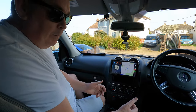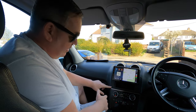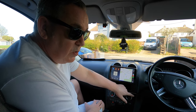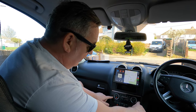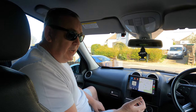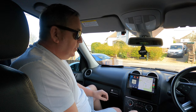There are three plugs on the back of the HVAC panel - just undo those and put it to one side. Just below where your old command system was, there are two little sliding screws either side with Torx 20 screws - undo those, then slide down the clips that are behind there, and the whole command system just falls out.